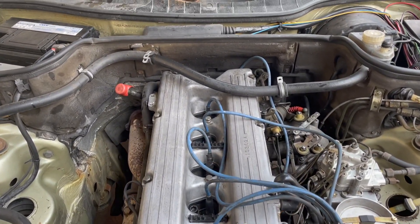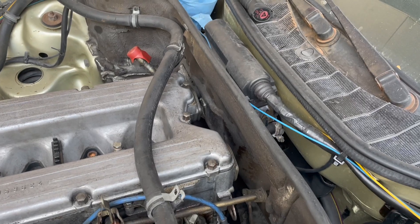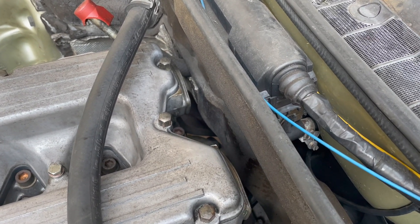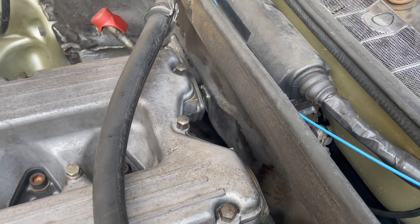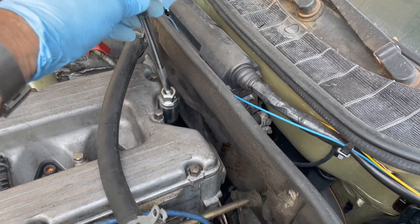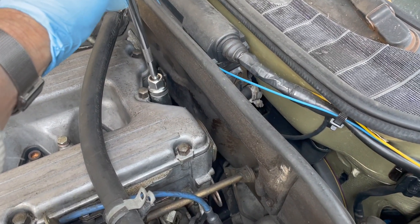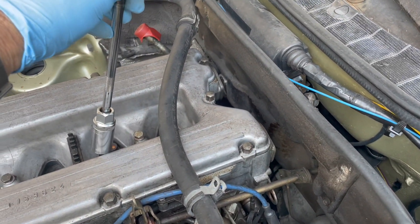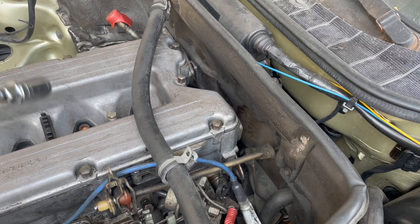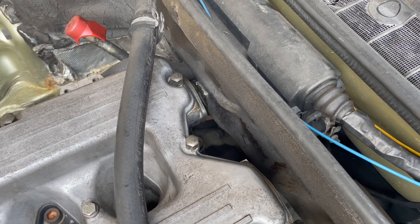You're looking at an M110 6-cylinder Mercedes engine, and we have a little bit of a problem — in fact, this could become a big wrench dance. The person putting in the spark plugs ran into a problem and said this rear spark plug won't go in. It's partially cross-threaded. He tried to start the spark plug in a hidden area with a socket, which moves around, and he was too straight in the hole. These spark plugs are angled, so you have to be really careful. I recommend getting on a ladder or up on top of the engine to look down in there when you start the spark plug in the number 6 cylinder.